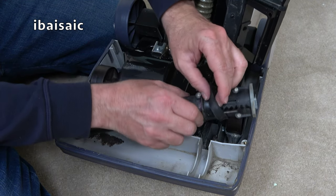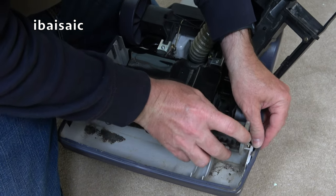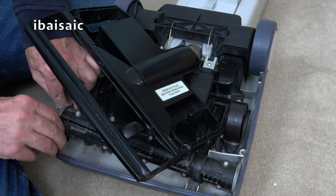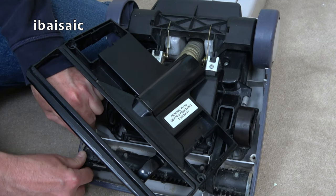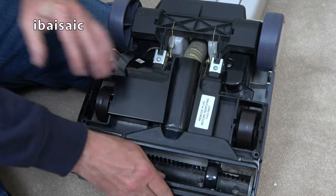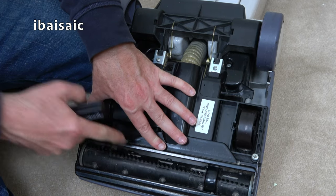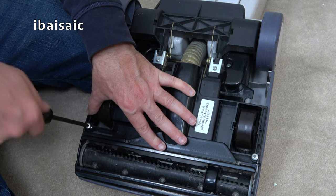Yes, I think I've got an Electrolux 550 here, and I might have put a new belt in that. This only goes in a certain way. Just into the ends. There's a little cut out. Oops, oh, that's not on, is it? There we go. Yeah, that's not going to perform well, folks, with that lackluster belt. I probably will be able to stop the brush roll with my hand with that worn belt. So that's going to affect the performance.